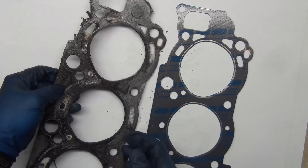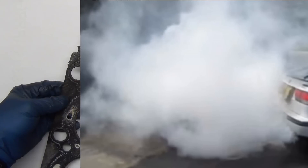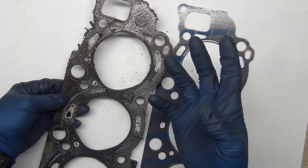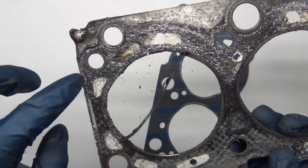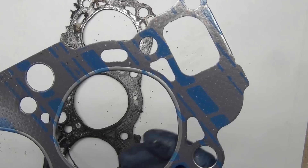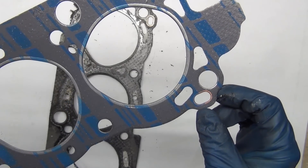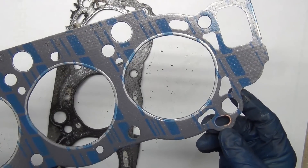When you blow a head gasket, coolant is going around here while compression gases and fire are happening inside those holes. Antifreeze gets in there and goes out the tailpipe. The other thing that happens is when that cylinder goes bang, it causes those gases — that smoke — to go into the coolant jacket and push it out, creating air bubbles. The coolant doesn't circulate; it gets blocked by superheated air. You can see where it's melted away and become destroyed. Cylinder six really got destroyed — it had so much coolant going into it that the piston is perfectly clean. And it's that white smoke that just hangs and hangs in the air.